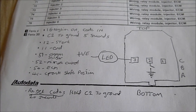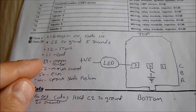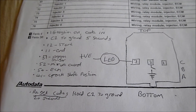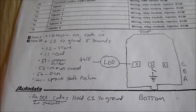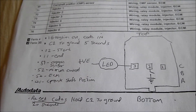But if your engine management light is on the car, like mine has been in the past, I'd got like five blinks, then a pause, then one — which means the oxygen sensor was at fault. I've had that a few times; I've changed the oxygen sensor maybe three times now. And so that's how you read it.